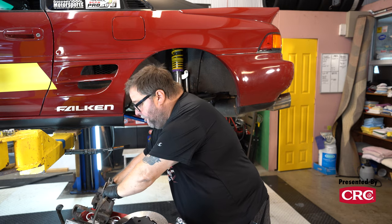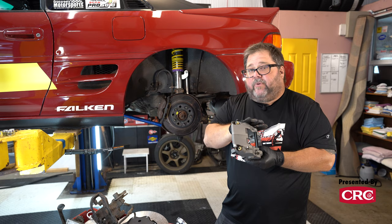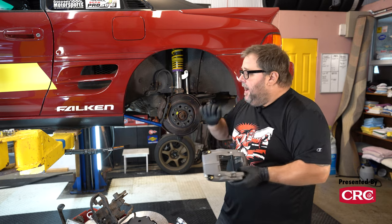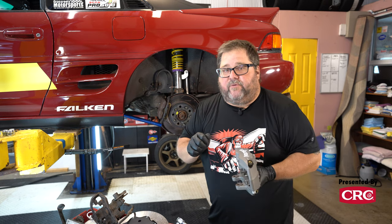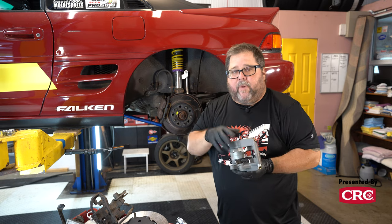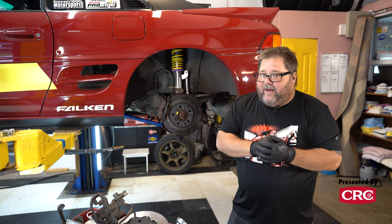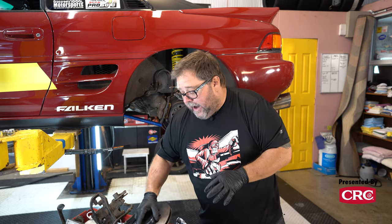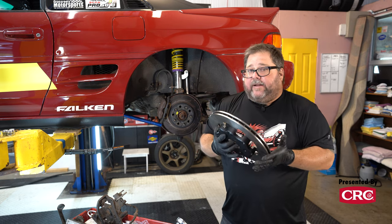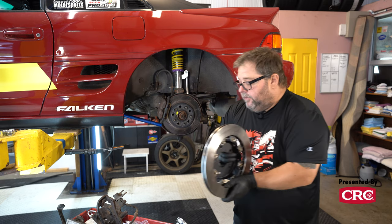One of the big upgrades we're making is to a multi-piston setup — in this case four pistons per corner with these Wilwood calipers. They're also considerably lighter. In fact, the entire system, even though it is much bigger and has much more friction area, is considerably lighter than the old system. Total weight for the new system — rotors, calipers, adapters, pads, hydraulics — is just over 70 pounds. The old system was over 78 pounds, so that is a substantial savings in brake weight. The rotors are slightly heavier, adding a little rotational mass, but I'll take that trade-off for increased efficiency, increased size, and an overall reduction in system weight.